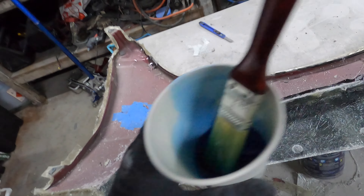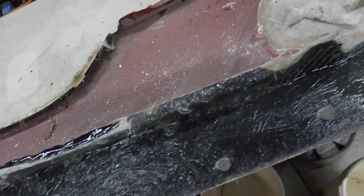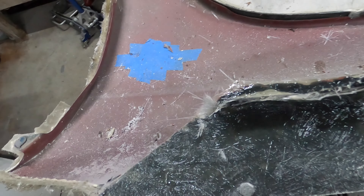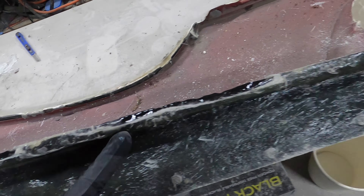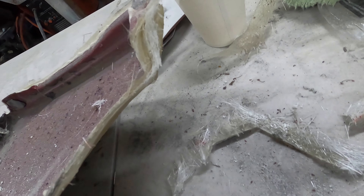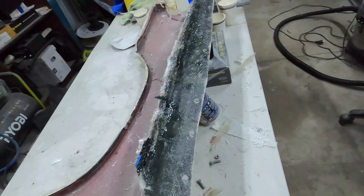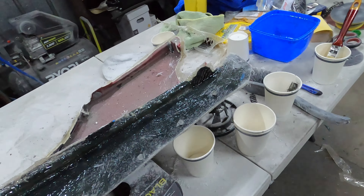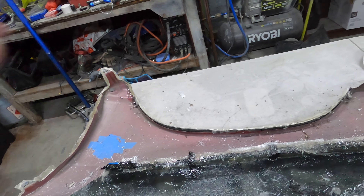You've cleaned up the edges. Mixing up 40 grams - should be enough. I'll brush that on, put some carbon fiber there, we've got some fiberglass, so hopefully we can get this looking good. Do some up this way as well. The better parts like here and here it's flush, we'll try to fill that gap up. Alright guys, it's nearly six o'clock - we'll come out when the boys are in bed, around 8:30-9 o'clock. Hopefully this should all be dry and we'll pull the guard out of the mold.